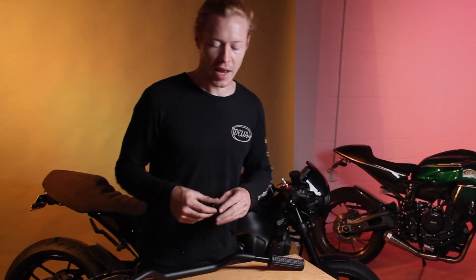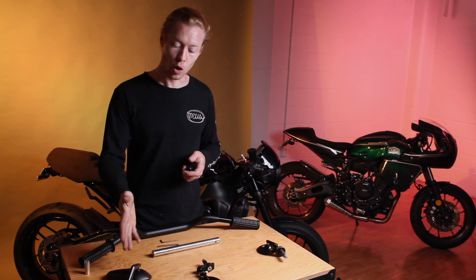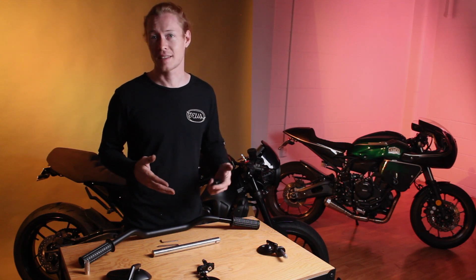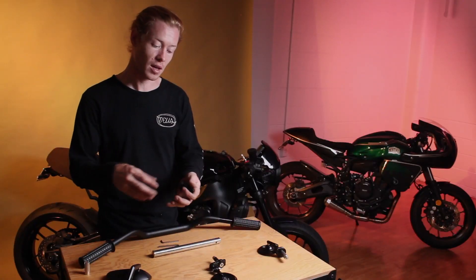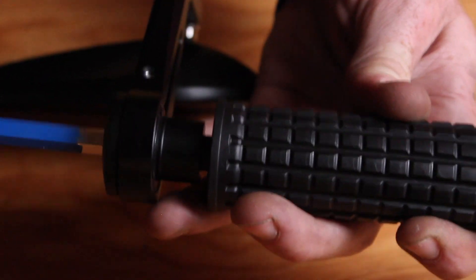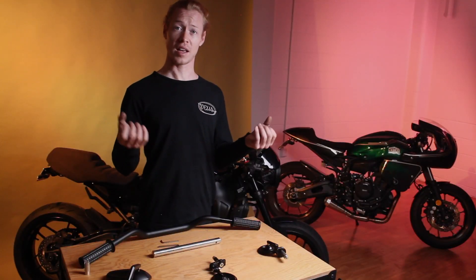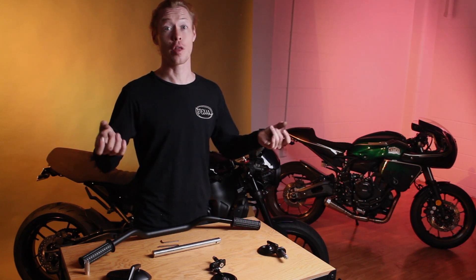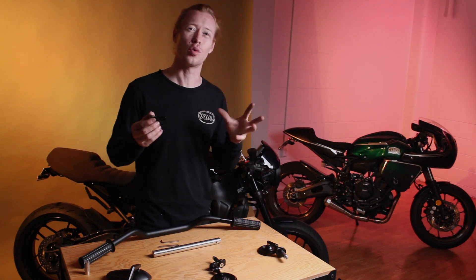We also now have a completely different product — a bar-end mounting adapter kit for our Throwback mirrors and Splitter mirrors — to go onto any of the first, second, and third gen MTs, XSRs, and all bars that have a threaded bar end. You take the clamp off the rest of the mounting material and slot it onto this adapter instead. It uses a 6mm Allen key to bolt directly into the threads on your Yamaha bars. For all previous gen models where the handlebars, grips, and throttle tubes sat out about 15mm further than the handlebars, these adapters have the perfect sizing to give you a really good fit with no loose excess.